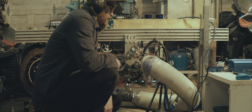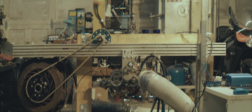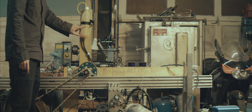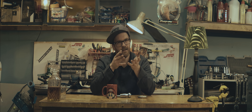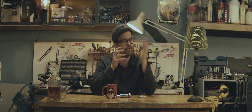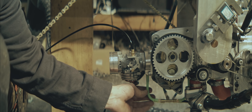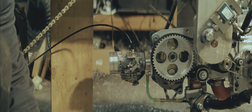Oh my God. I ran it out of fuel. That was stupid. We've had some runs now that make more sense and I'm fairly confident we're running out of fuel, even when I remember to fill up the tank. Could be a pulse line problem - it's connected to the plenum just after the blower, not enough pressure fluctuations to make it work. That could be a problem.